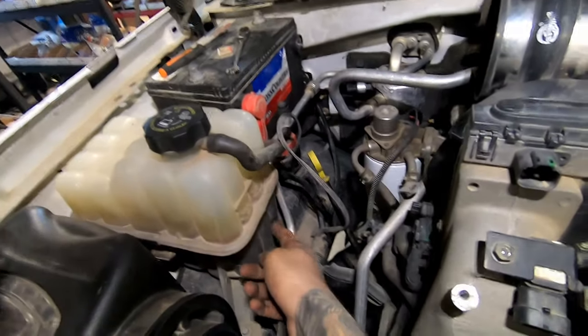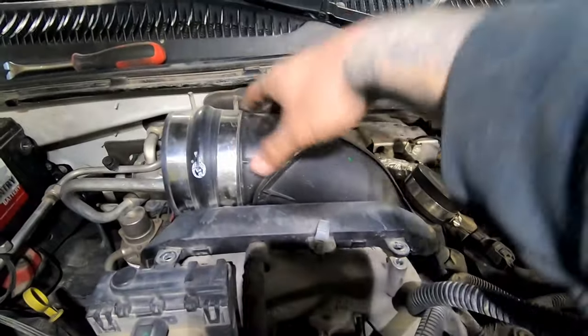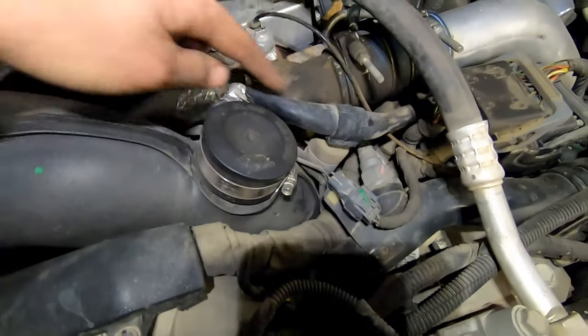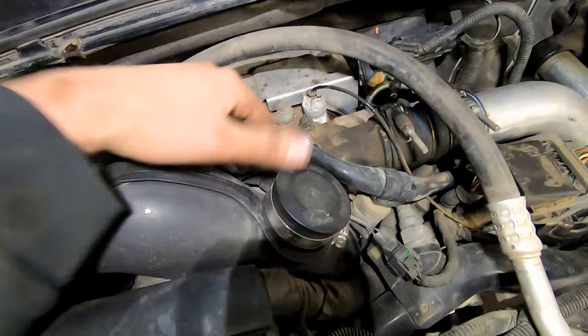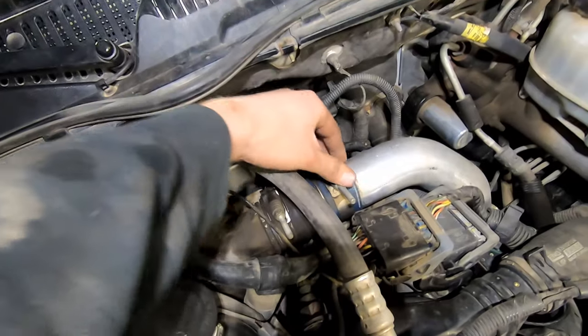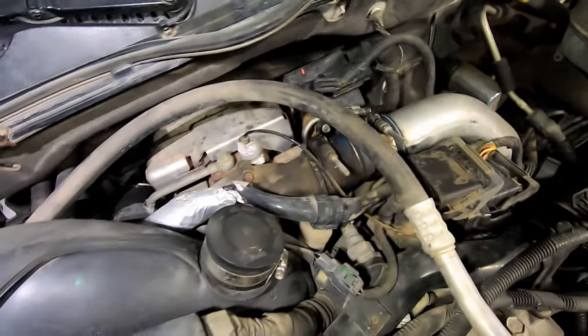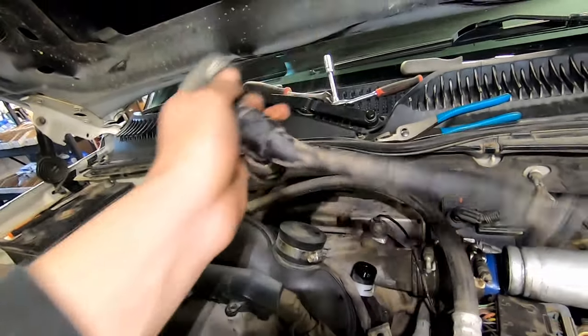Wiring's loose and I got this whole harness moved over to the side. I unplugged the coolant level sensor and the one on the AC line back there. There's a sensor here I'd probably disconnect and get out of the way. This is your PCV piping — it goes to each valve cover. There's a 10mm bolt, and then there's a V-band clamp that holds the intake horn onto the front of the turbo. I'm going to disconnect the boost pipe and move it off to the side to get at that bolt.